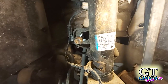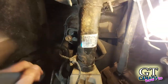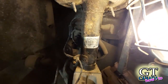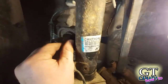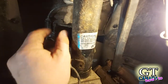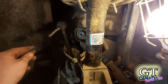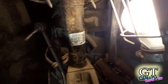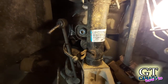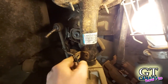Now that it's loose, I used a 15 millimeter deep socket. You might have to tap it to get it free. Make sure you've got the nut on a couple of spins so you don't mushroom the head of that bolt, because we're reusing it. Now that we've got that sway bar link out — that grease is from when I super greased this thing when I put it in, it's not leaking. We've also got this ABS wire; you just slide it off of here and trace it down into there.